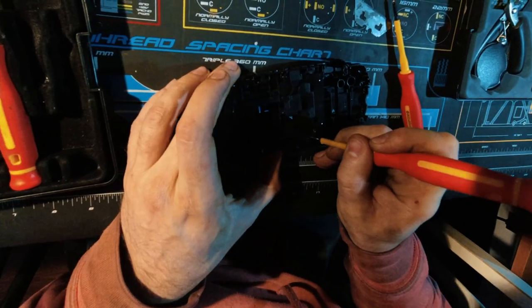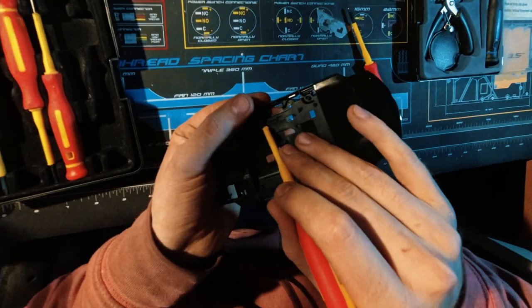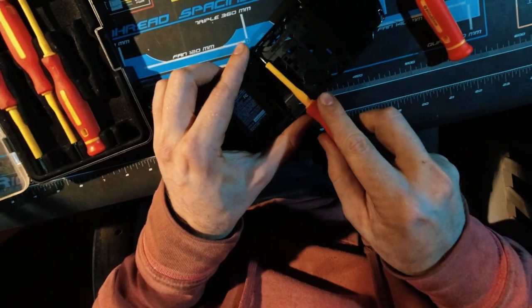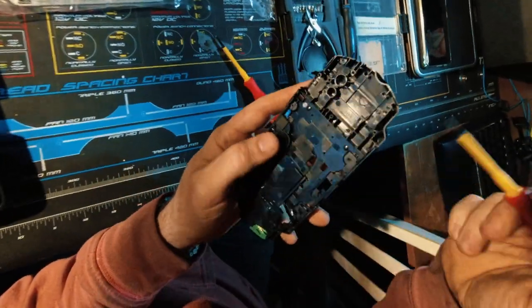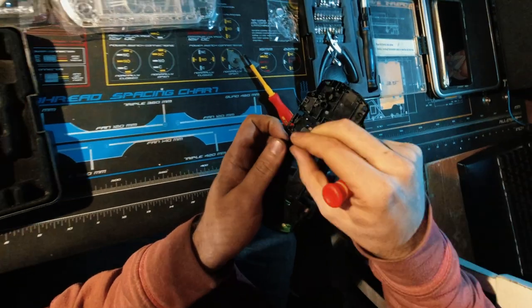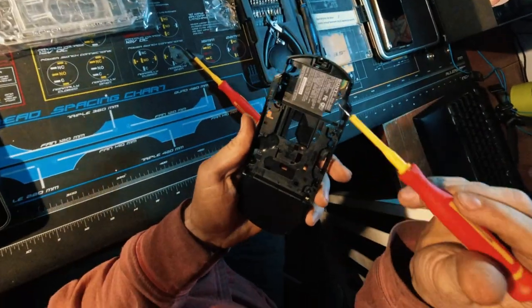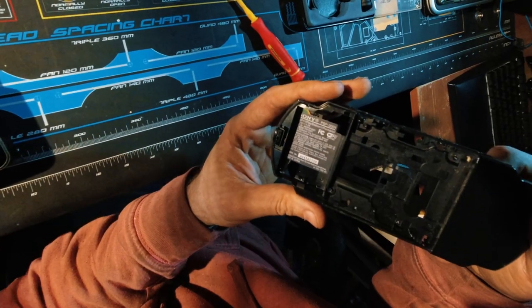This just has two clips right here and right here. My thumb goes over the spring so it doesn't go flying. I can just pop that out through the top. Now we just need these little metal tabs and this little rubber block right here. I just have to take the rest of that sticker off right here so I can take the wifi board out.